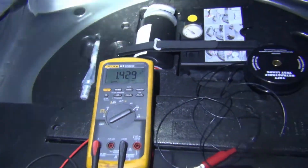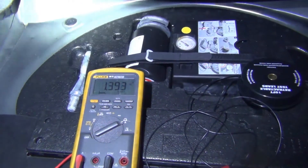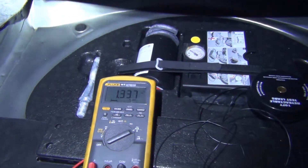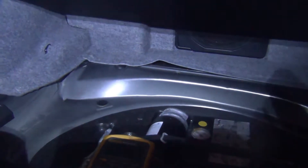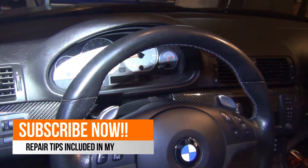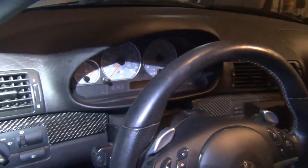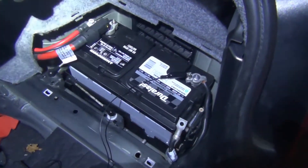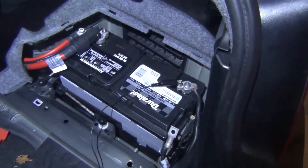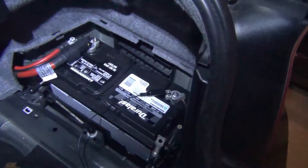With the door open now, this particular car — even though it does the 200 milliamp spike from the instrument cluster via that OBD2 fuse — I also found a 600 milliamp spike from another component. I had disconnected a few components as part of my regular testing and eliminated a drain I didn't even know the car had. So I like to actually test drive the car and reset it up for a parasitic draw test after I've eliminated possible causes, to rule out other things besides this instrument cluster. I did have another drain on the car, and I'm glad I checked — otherwise it would have drained the battery in a couple of days for the owner, and this is a new battery we just put in for him.